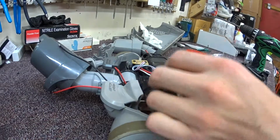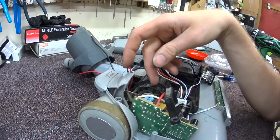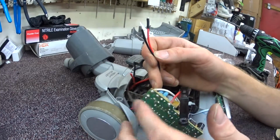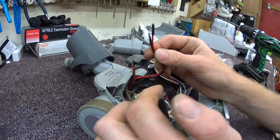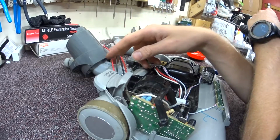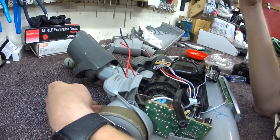Alright. So now we're giving kind of a strange option here. I could desolder the wires to hook up the new plug. And by the way, these come with these quick release plugs, but even when you order one of these boards brand new, they're never plugged into the board, so they're crimped from the factory for something it never was. So I can do that, or I could wire nut them on, and then I can tuck. There's plenty of room up here to tuck wire nuts in.